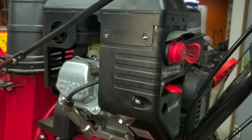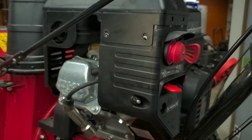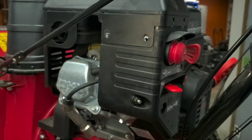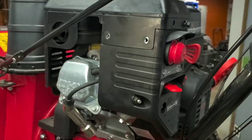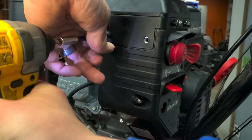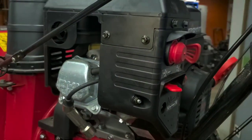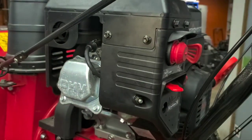Line up the choke with the hole, pushing left and pulling up and out simultaneously. Line up the holes down below — up and under with the top. Line up the bolt holes and put the two bolts back in the front. Put the 8 millimeter bolts in for the top. Start them all first to make sure they go in straight — you don't want to cross-thread any of them. Then put the spark plug wire back on.